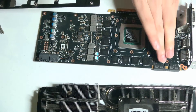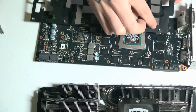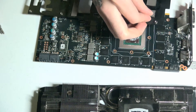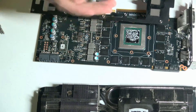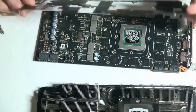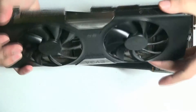This is a three gigabyte GDDR5 graphics card. These here are what's called thermal pads — some people refer to them as thermal band-aids. They're made of this thermal conducting material, and the heat from these chips gets transferred over to this back plate, which then gets transferred over to the heatsink.